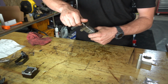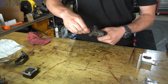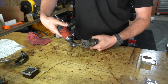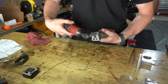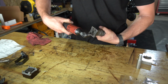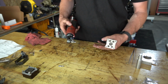Now I couldn't find any torque specs for these Allens or these Torx screws, so I just tighten them down. Not too tight, not too soft. Now what I'll do is go back and forth throughout them. The impact is not here right now, so I'm tightening them down evenly, collapsing it on that spring. I think that's pretty good for the torque. This is probably about 20-30 foot-pounds.